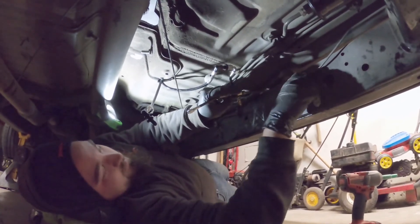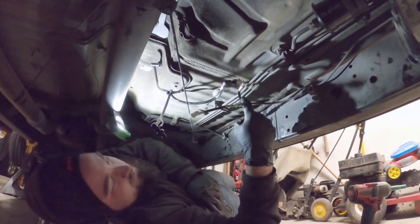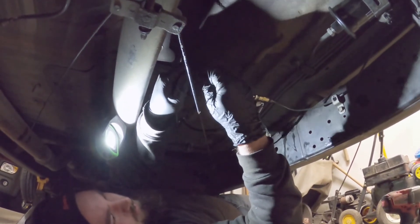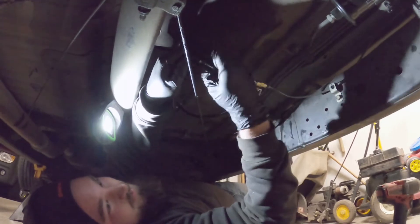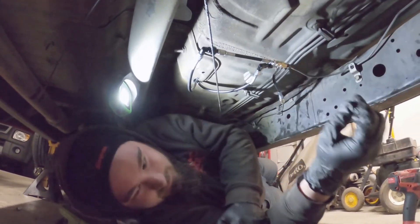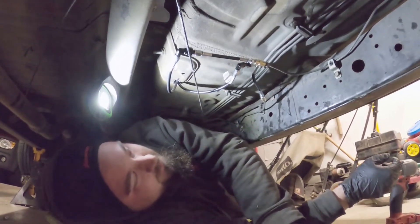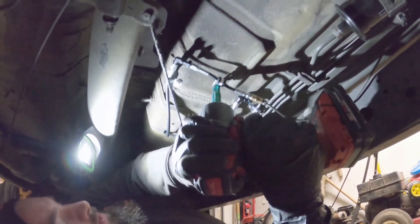This isn't necessarily ideal - really you wouldn't want this little line in the middle here, but it's needed to adapt. Somebody who watches this from Chase Bays is probably going to say 'retards.' Well, you guys need to make a kit for everything - make a kit for a Tacoma and we won't have to do this. Cars only - got it. All you have to do is extend those two lines and change the fittings. I'm securing the lines to the bottom of the cab with these little rubber self-tapping screw guys.